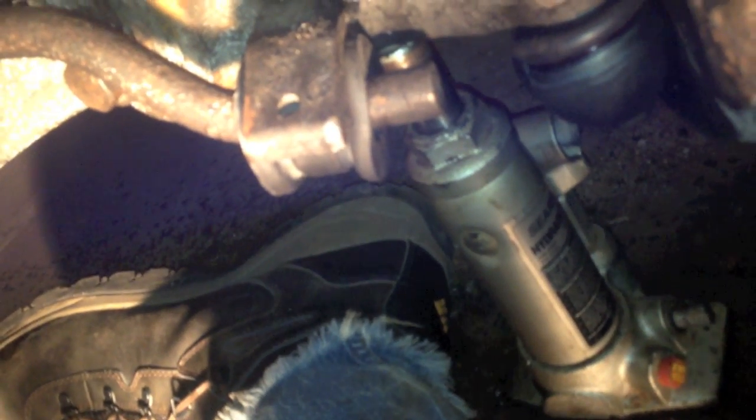Okay, so the control arm bushing is in place. I managed to jack up the control arm a little bit, and then grab and pry the sway bar down below here again. Now the bushing's in place. I just wiggled it on. It's a new bushing. You should get new bushings too. They're kind of cheap, and they can add some stability to your car.